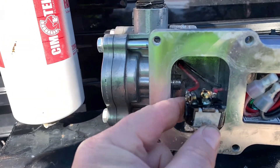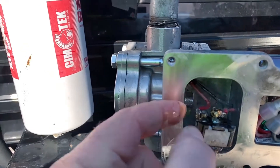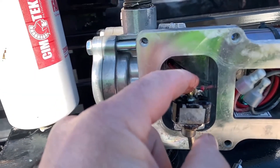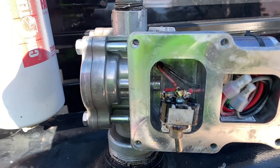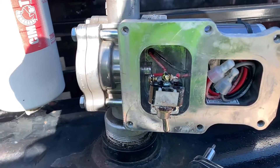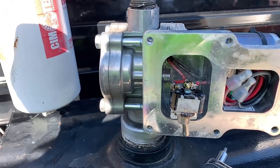I'll show you inside of the 2007 Ford — it's got the Power Stroke with the auxiliary switches. I'm going to take one of these loose and tie it into this other one, bypassing this switch and just turning it off and on with the aux switch inside the truck whenever I need fuel. It's winter time here in Tennessee and I'm needing to put diesel in the tractor and I'm stuck. Anyway, I'm taking this apart to show you what may be a problem with yours if you've got the same kind of pump.